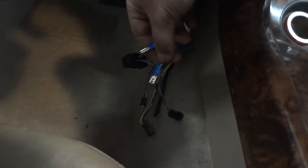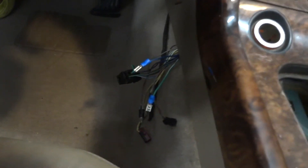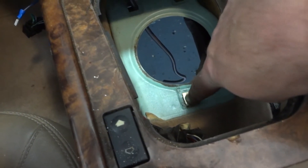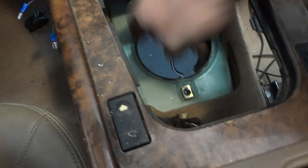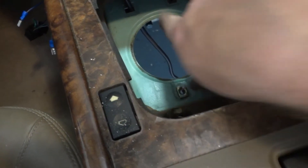I ended up putting a couple of blade-type connectors on my wiring harness, and those will join up to the two cables off the transmission shifter. Once I get the transmission in and confirm the cables are long enough, I'll connect those and put shrink tube over them. I routed the wiring through one of the automatic shifter mounting holes — the rear hole isn't ideal because that's right where the rear bushing for the manual shift linkage sits, so one of the offset holes works better.